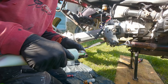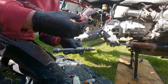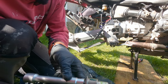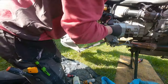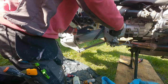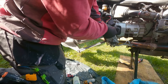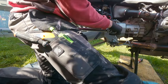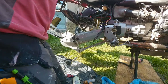Put a little bit of normal grease on the pivoting point and a little bit of green Loctite on the threads — just a little bit, that's more than enough. Torque is 150 newton meters to tighten this bolt, which is an awful lot. I spoke with the mechanic — he says just put a little bit of grease on it and that should do it. 150 newton meters, then go to the other side and rinse and repeat.